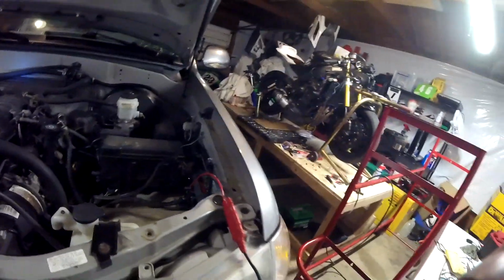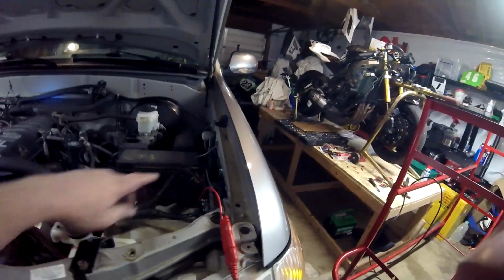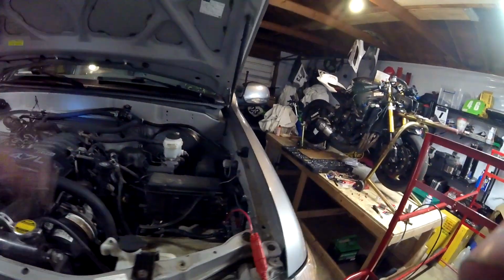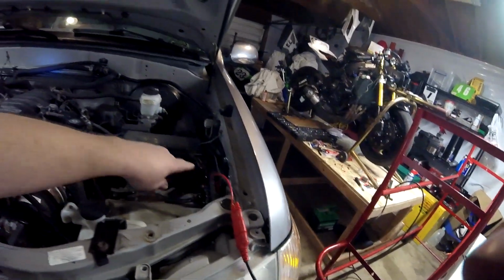Everything's really tight. Any of the lugs were mashed and soldered, and any of the connections were well made and tightened up and torqued and triple checked. So if this screw were to back out and fall down and short one of these to the other, they're both positive anyway, but if it was to short one of them to negative, then we'd blow a fuse, right?